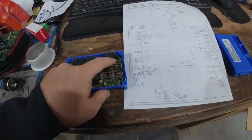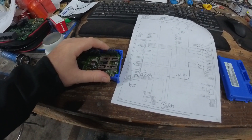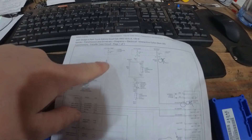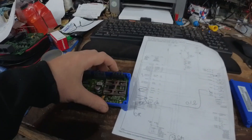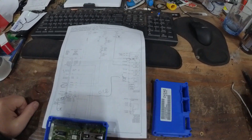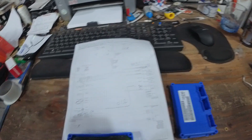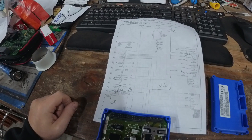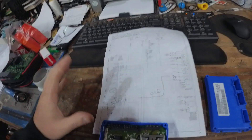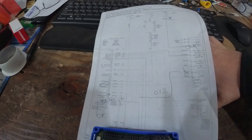See, they're labeled A, B, C, D — because they did that back in the day because they cared about service techs. That's a joke. So we got power ground here at A, and then we got B which comes from fuse A20 — that one says 4x4 under the hood. Then we got C and D which alternate the voltage for the transfer case motor. There's also a fuse that controls the lights, and then fuse 12 for the park neutral position sense, which tells it what gear it's in because it really doesn't like to shift if it's in drive or reverse.